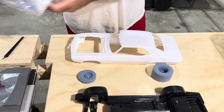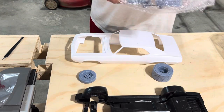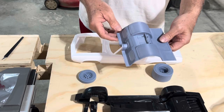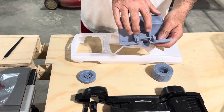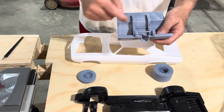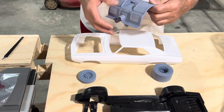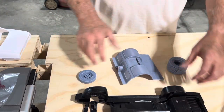We're going to open up the back half. I like taking measurements before we even start doing any cutting on these kits. This is the back half that you'll get from MCV. Of course, you'll have four-link bars coming off here, and then a narrowed rear end accompanied with two coilover shocks and a track bar going in between here, and then a ride height adjuster in here that you can adjust. But really what I want to do right here is take some measurements.